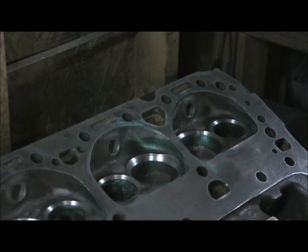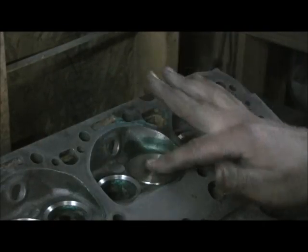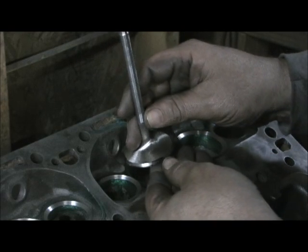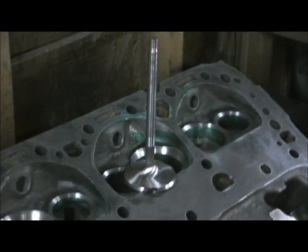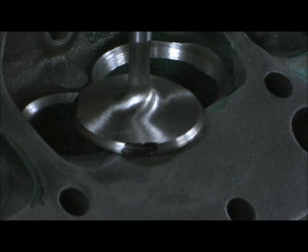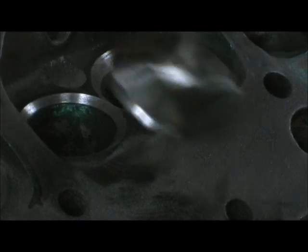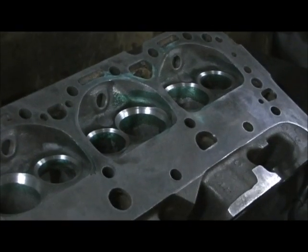Now to check this, what we do is take a valve which I've marked with a black Sharpie, and we just bounce it and pull the valve up, and look at the position where the two lines intersect. It's still a touch to the high side — a little bit high. I'm trying to move that line down near the bottom, so I'm going to face off on this a little bit and dig just a little bit more.